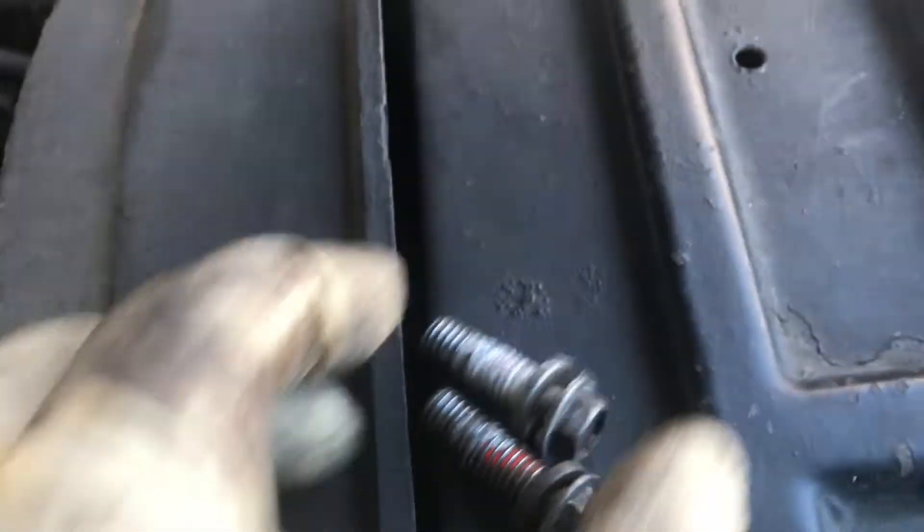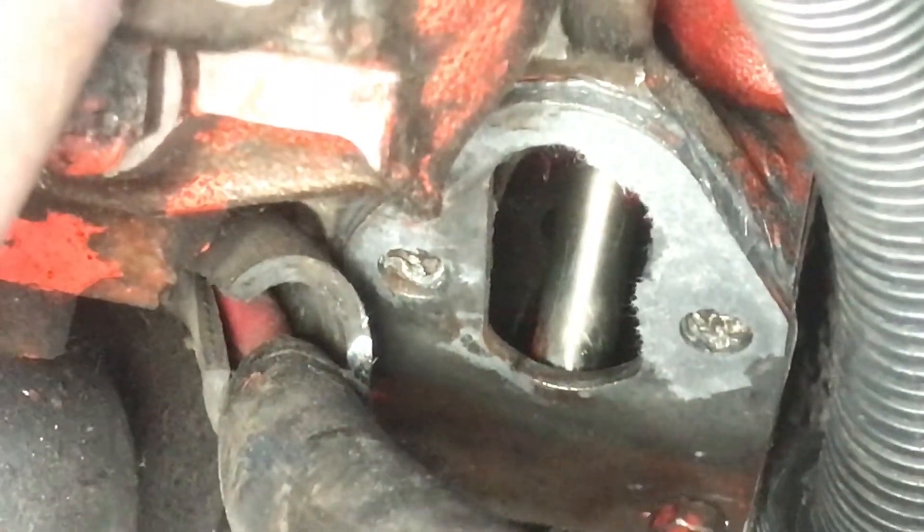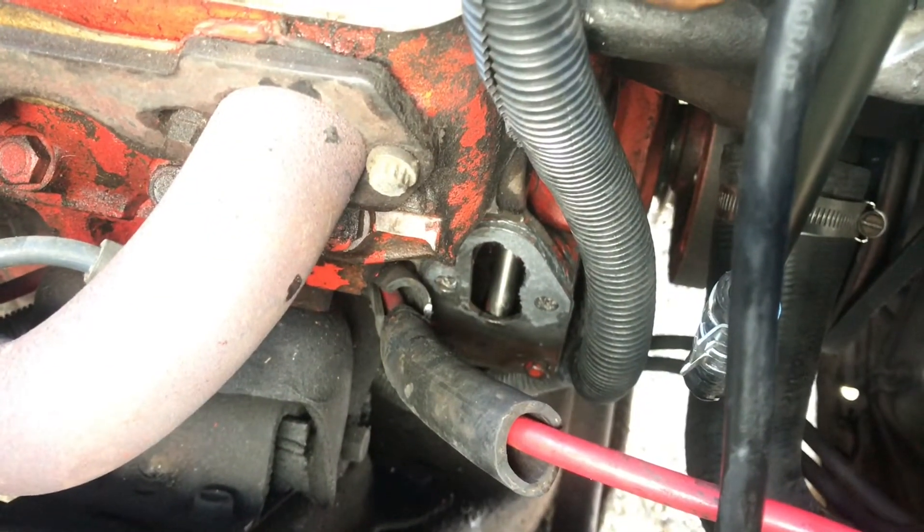There's the gasket — I've got to scrape that. But when the pin is down, I think I should be able to slide it back up without taking the plate off. I'm having a little trouble getting my pin to stay up and I don't want to take this cover off again. I put some grease on it but it just doesn't want to stay. So I'm going to try and just do it with a screwdriver. The instructions mentioned a hacksaw blade — just because it's really thin — to go down in here and hold the pin up while I slip the fuel pump in.